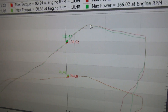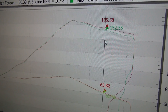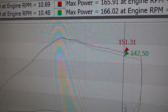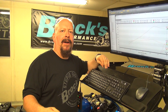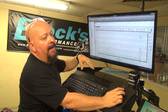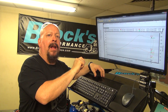But watch what happens over here. The green line — we're not closing off the crossover tubes — and you can see a definite dramatic reduction in horsepower and a couple foot-pounds of torque. Peak horsepower is definitely affected by having those crossover tubes in place. So if you've ever had the discussion that crossover tubes hurt peak power, let them look at this chart — it shows that crossover tubes most definitely hurt peak power. Are they helping along the curve on the front side? Possibly. Same with the X-Up valve. But this is a wide-open test. So we also wanted to check our real-time horsepower and real-time torque. We're going to try to put this to bed and move on to other things right now.